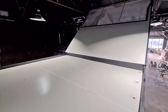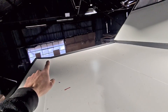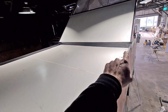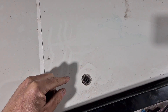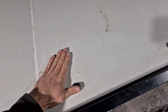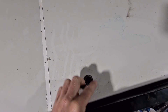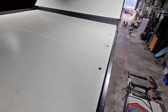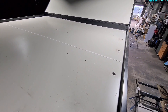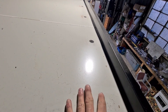On the roof there's going to be three solar panels — one up there and then two here — so water will hit that roof and run down onto this roof. This has got fall: that's the highest point there and then it's got about 20mm fall into that corner. These are the openings to the downpipes — there's a flashing underneath this roof sheet and then there's a pop with a hole in it. I'll put some mesh over the hole to stop big things going down there, and then the roof sheet goes over the top. I'll put half a dozen pipes in because there's only about 20mm of fall, so if the truck's on a bit of an angle the water will still be able to get away. There's a little parapet wall so the water will come down, hit this wall and go down these holes.